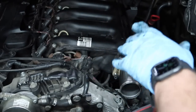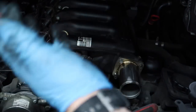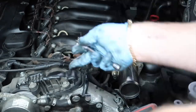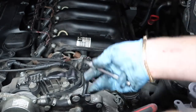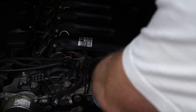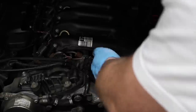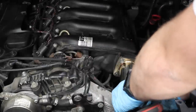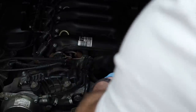There is another blank you can get with the pipe that comes off, and you can leave the pipe on if you really want to, but on the E53 there is no point — we don't have the EGR thermostat. A lot of you on E60s also want to get rid of that pipe to save on the EGR thermostat, and I completely agree — blank it off because it doesn't make sense to pay for two thermostats, especially not for any emissions-related product. So blank the whole system off altogether — that's what I did to make it a lot easier.